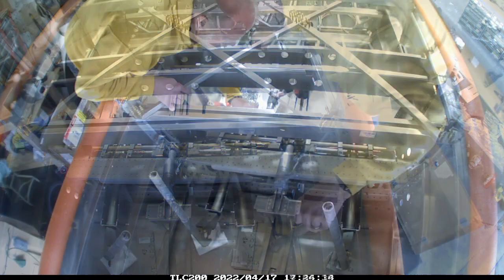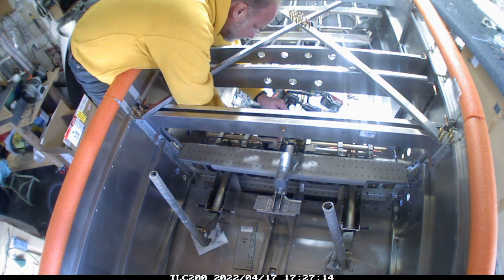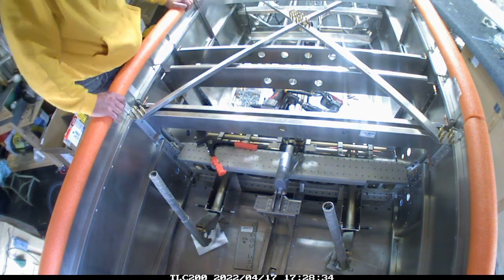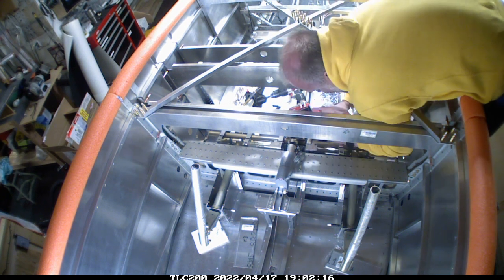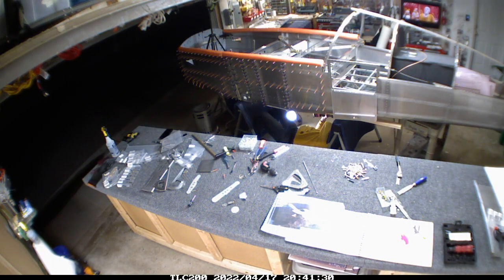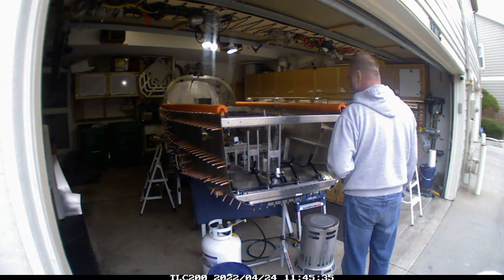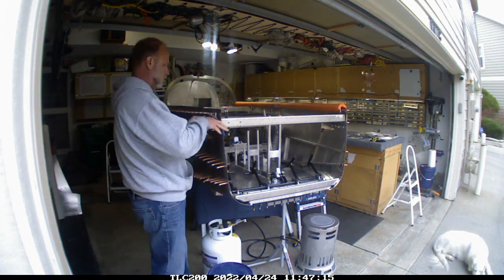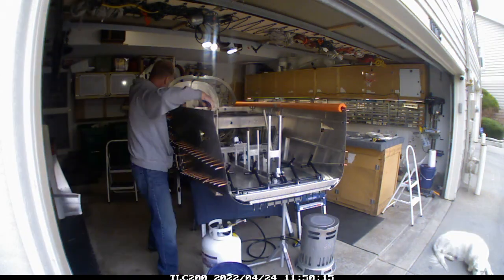I'm sure there are a lot more adjustments I need to make and that will come along. Maybe that's the reason why they don't have you do it earlier in the process, but the eye bolts sure seem like a good time to do it. Here I am riveting the parts that are holding the control rods in place — I finally got around to that — and I had to use a hand riveter because the Milwaukee rivet gun is just too big to fit in those spots. Here's where I was getting around to riveting the forward fuselage to the rear fuselage — quite satisfying — and then I felt comfortable enough to take the firewall and side skins back off so I don't have to climb up and over into the fuselage all the time to continue working on the mechanical portions.